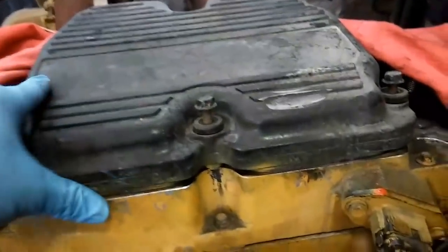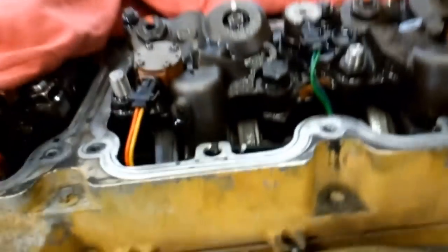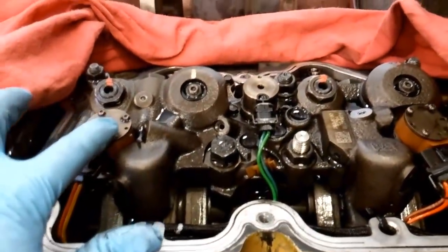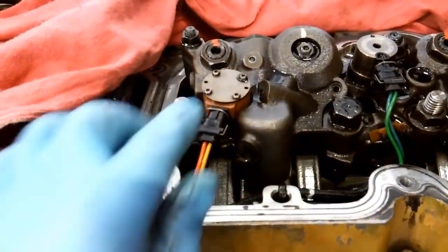The first thing you're going to have to do is remove your valve cover — standard C15 valve cover here. We're doing solenoids three and four, and they're numbered after the cylinder. So that's your Jake solenoid, this is your IVA three, and that's your IVA number four, sometimes also called VVAs.